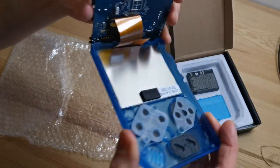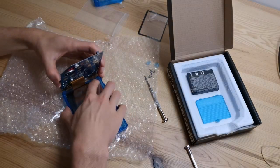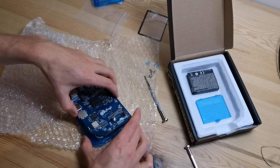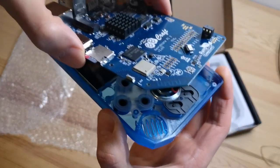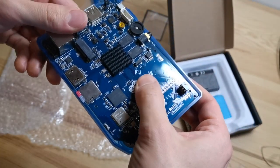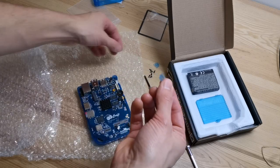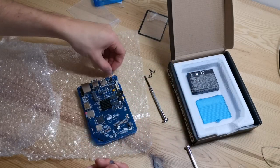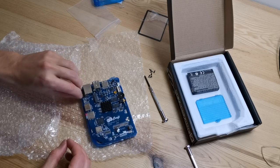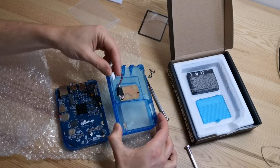Check closer — it looks like it's okay; it's right in the cavity. Now put back the PCB. Make sure the speaker goes into its cavity too. Now put back the two plastic buttons. Don't forget them, or dust will get inside. Put those two buttons here and here. Then connect the L and R buttons — don't forget or they will not work. Connect them by pressing on the side of the connector until you hear a click.